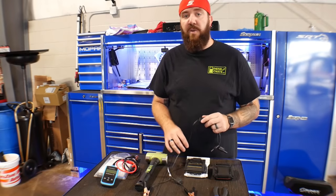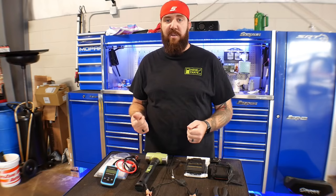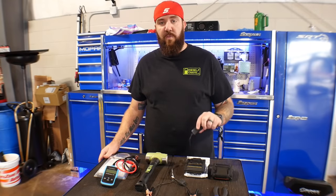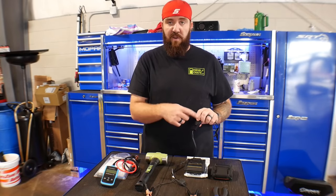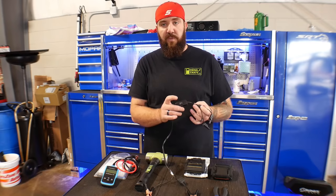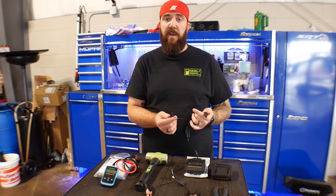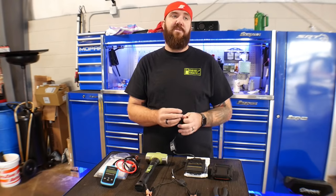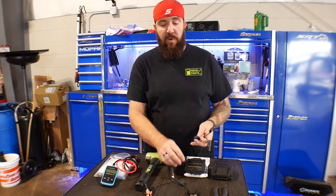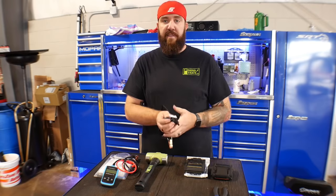If anybody's ever tested for a battery drain, they know that the worst thing we can do — especially to our meters that are hooked up — is connect the battery back down with our clamp, because it actually spikes the battery system up so high. If anything's on or if the door's open, it'll blow the fuse in our meter, which is like a $30 fuse anymore. So this will reduce the risk of doing that. Connect these and it connects the circuit already with the cable ends. They're plugged into your meter on the amperage and ground ports. Then all you have to do is flip the one switch, and it will put that amperage from the vehicle through this back into the vehicle and through the amperage portion of your meter — without that amperage spike and without having to wait the extra two to five minutes for everything in the vehicle to go to sleep. Saves you time and the headache of accidentally blowing fuses on your meters. It also has two inline 10-amp small blade fuses. Saves your meter, saves you headaches.